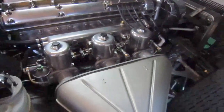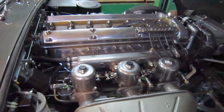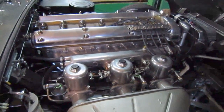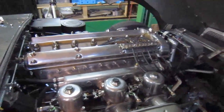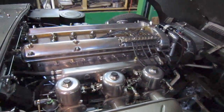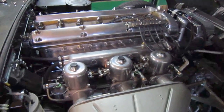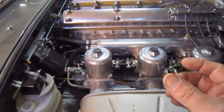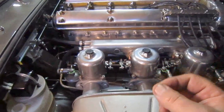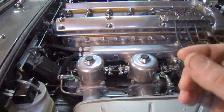We're getting further and further forward. I've got the mud guards to put on and the main thing is getting these carburetors sorted out. I'm going on a rally in two weeks time — it's a timed rally, not a speed one, a local one up near Vienna. I'll report on that when we do it. When I start on these carburetors I'm just waiting for the parts to come — specifically the screws for the butterflies, because when you do the butterflies the screws have to be slightly splayed apart. It's really important that you don't reuse the screws, because once they've been splayed and closed again to remove them, you don't want that happening more than once. Imagine that dropping inside the piston — would not make a nice sound.